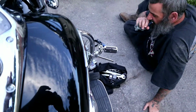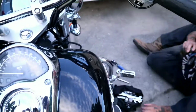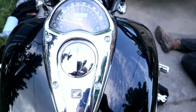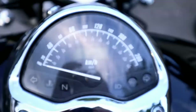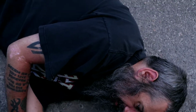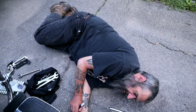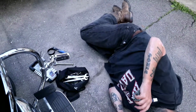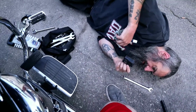Okay, so let's sit here for a minute, guys. Enjoy a nice break on Trippy's bicycle. Trippy's been time lapsing the whole time. Squeeze the clutch a couple times, guys. Get that oil out of there. I've taken the filter off. I put the new filter on. Now we're just double draining, which will be good. It'll be good this way, and she doesn't drain out this way when I lean it your way? Only in the middle?